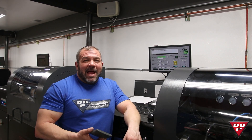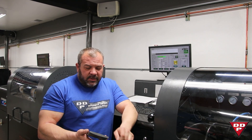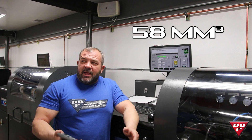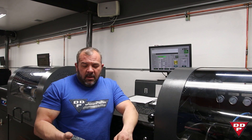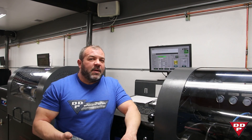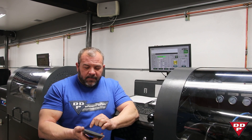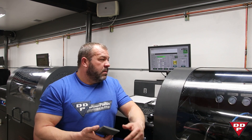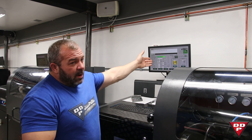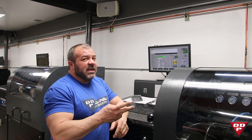We were at 131, and now we're at 189. So 189 minus 131 equals — we just gained 58 mm cubed. And we claim that we're able to make about 3.5 horsepower per mm cubed. So if we can actually make 3.5 horsepower per mm cubed, we take 58 — which is what we just gained — times 3.5, that's 203 horsepower gained from increasing pressure and increasing pulse width to 2400 microseconds.